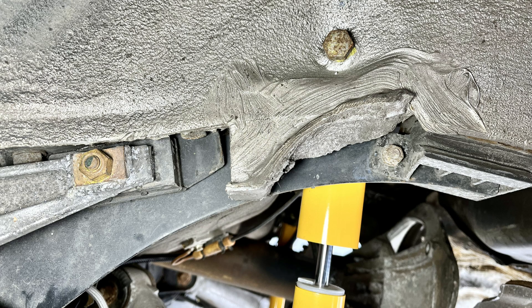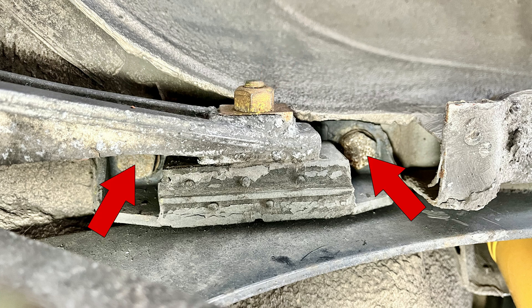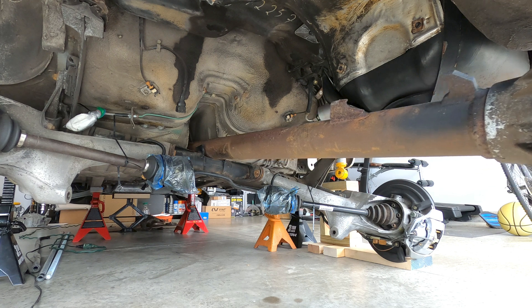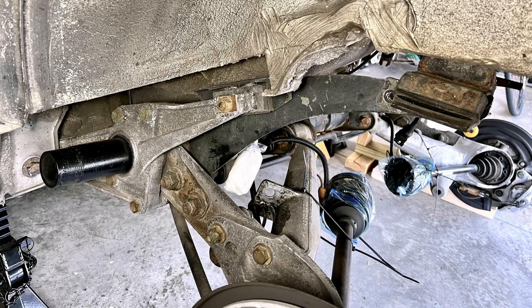The remaining connection points consist of a 13mm nut and bolt setup at the upper cross tube bracket, the one 17mm nut or the two 17mm bolts at the rear bearing flange bracket, either way, and the 19mm bolt that secures the lower bearing flange to the chassis. One item of note is that the torque tube can be removed by lowering only one half of the suspension, where all the aforementioned bolts have been removed with the exception of the 19mm bearing flange bolt on one side.